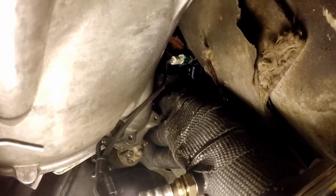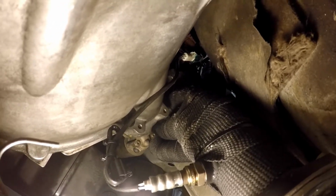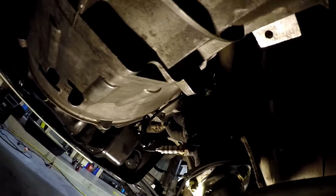Also, you can see this. Here's where that coolant, see the drips there. This is where it's messed up, because I cannot for the life of me get to that very well. There's a flange on the back of the head that has the two pipes coming off of it that go to the heater core. I believe one tube goes towards the front of the engine in the V, and the other just comes right out the back of the head. But it's way up in there, and some of the stuff on this car is so hard to access. But we'll see.